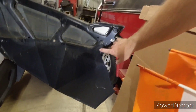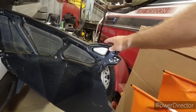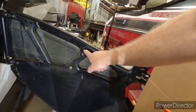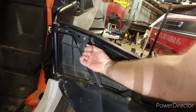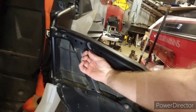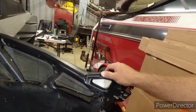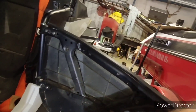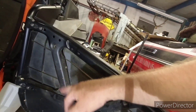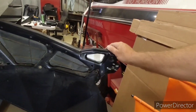So the lower door panel here is held on by one of the lock screws, which is also what holds on the door bag. These right here are the holes that we were trying to access. You could put the nut on there, but trying to get a wrench in there would just be a nightmare. It's not that hard to take this stuff off, so just make it easier on yourself and undo it. I've got a screw here and here and the lower section will be off. There's one under here, one under here, one under here, and one right here — then the upper section's off.